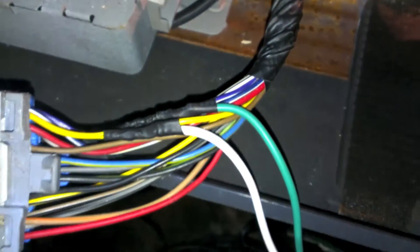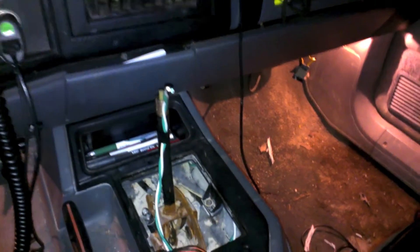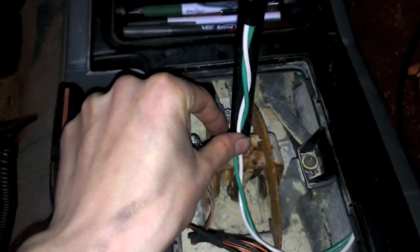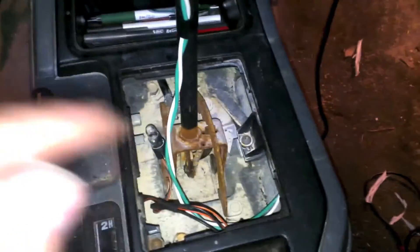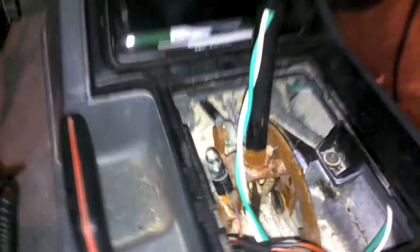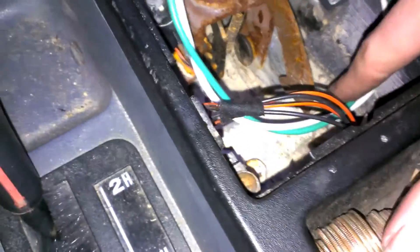To make all this work, you just connect your green and your white together, and there you go. I'm going to plug this back into the computer, put that fuse back in, and then run the wires around the dash. With everything screwed back together again and cleaned up, here is the last step. I have my wire running back behind this little bracket right here so that it just sits there, because it's going to sit in front. Doing some measurements on the plastic — there's more room at the front full bottom than there is at the top. With this setup, you can shift through everything, and the wires don't get hung up because they float back. I don't want them to get hooked up in that ratcheting system.